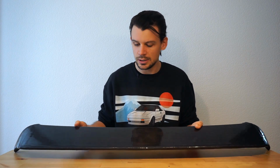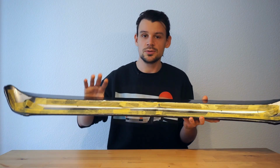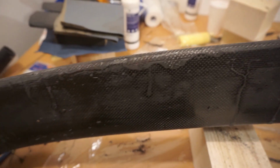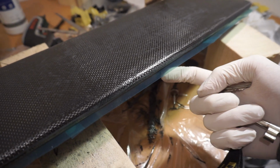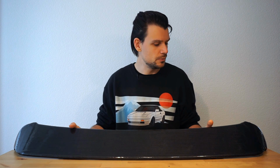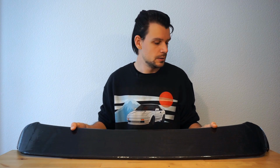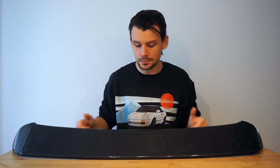And this leads to doing the lamination on this side, let it dry, turn it around, do the lamination on this side, let it dry, having teardrops on it when the silicone tape is not really tight, sanding this side, doing this side again, and then you have teardrops on this side, and it's still not very beautiful. So I need another sanding and maybe another coating on it to get a very smooth surface.